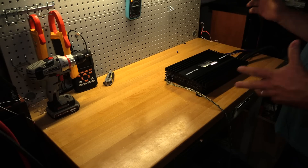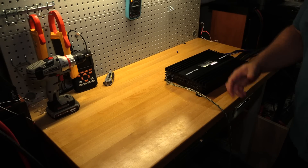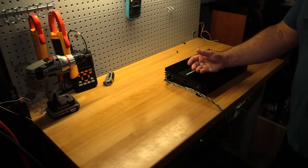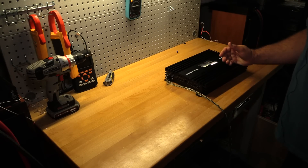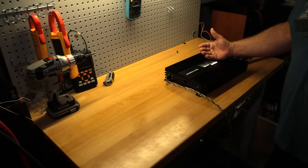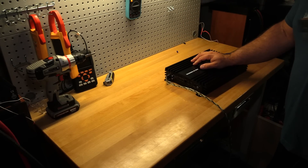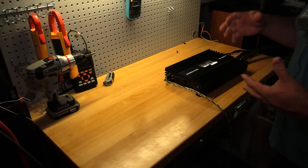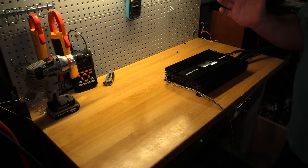Uncertified we got a shade under 2000 watts, and we still got a shade under 2000 dynamic — so it's close to being a 2K, and it's a lot better than what I thought it was. Is this a budget gem or budget bust? Previously I said it was a bust because it didn't come in under the cost-per-watt threshold. Now at 13.6 cents per watt times the 1900-plus uncertified watts, we get about $269 — and that is the reference number this amp needs to stay under to be considered a budget gem. It does it. We are officially changing the rating of the VFL Audio Comp 2K from a bust to a gem.